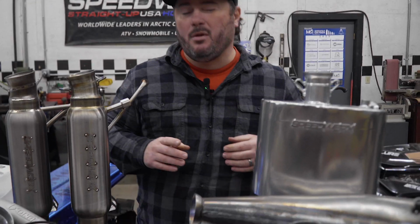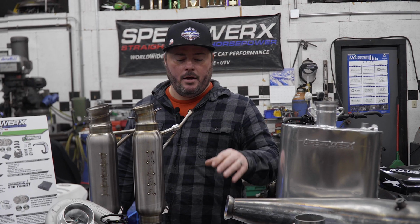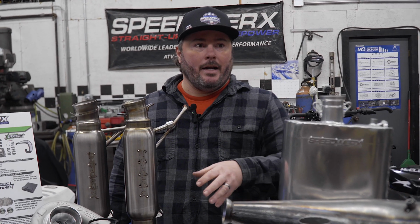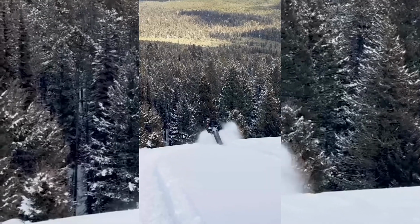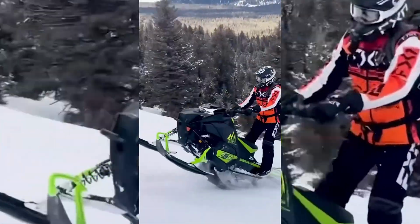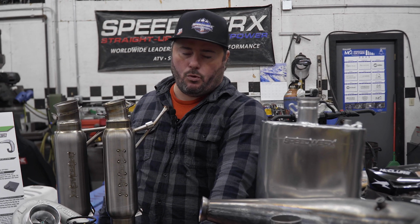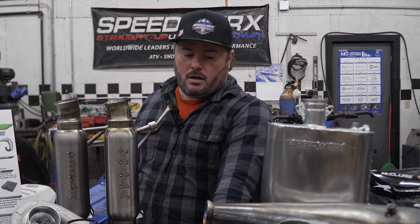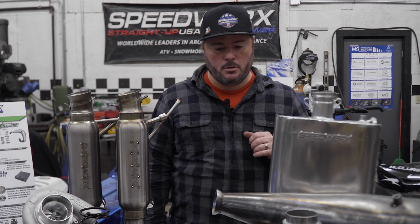It's stuff that's been going on with the team clutch for a little bit over a year, on the Polarises and other models like that. It worked really good on there. Everybody asks, what does it do? The best way to describe it is, it just does everything better. When you get in those real heavy load situations, like if you're catwalking and you ski slam down and everything's got to back shift real hard and you want to wheelie back up out of something, or real high load racing situations, that's where the 3-roller stuff really comes into play. So it's not only a spot for us to save weight, but there's some upgrade stuff we can work with there too. As the season progresses, more of the 3-roller stuff will get talked about and be options.